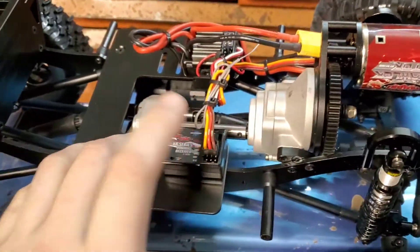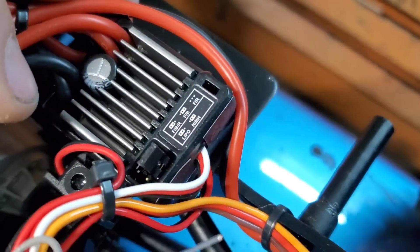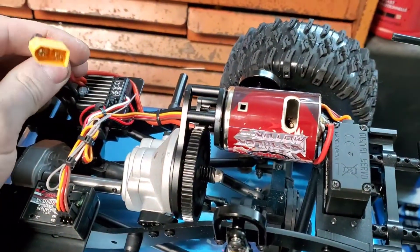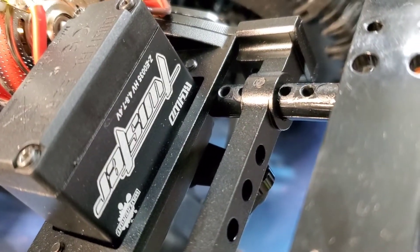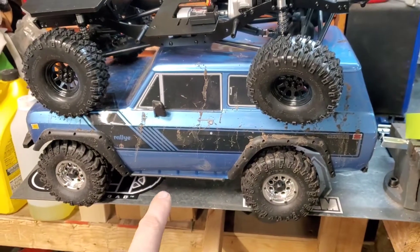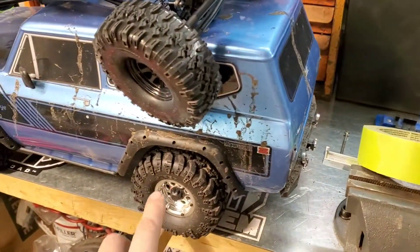Let me show you the inside of that RC four-wheel drive truck. It's just a basic four-channel receiver, a little ESC. I don't have any batteries with that plug — I might have an adapter. It's just a little 35-turn 540 brushed motor and a little RC four-wheel drive servo. I went out when it was warm here, but I gotta fix that one tire — it just spins. I think the hex on the backside of the rim stripped out somehow.